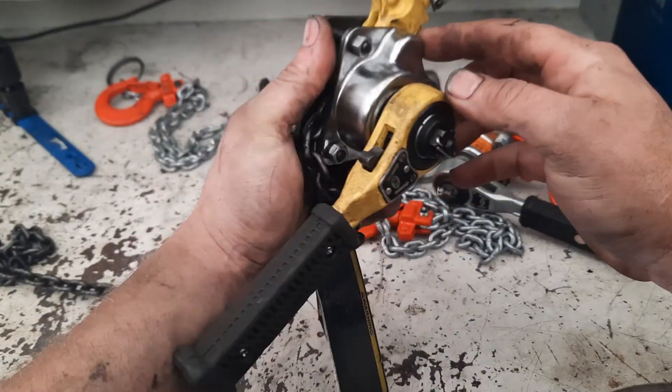The only reason I haven't done that is you'll have less pull-up range, which is the reason I needed such a small come-along. I have half-ton and three-quarter-ton come-alongs, but using the spreader bar across the frame, the distance gets tight once you get it wheeled all the way up — so you can hold the driveline, pull the carrier bolts, and lower it as an assembly. In the past I'd have to disassemble the driveline in multiple sections by hand unless I had a second set of hands.